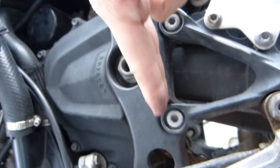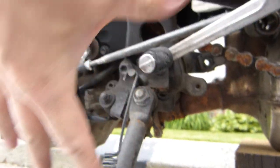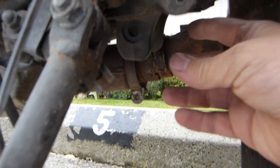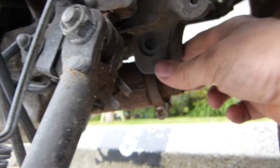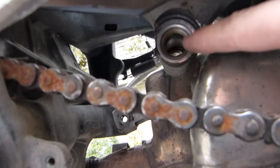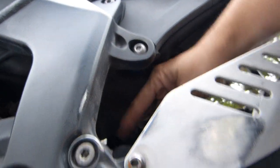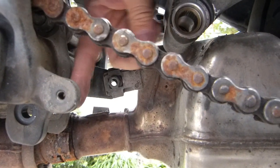This part of the frame is the extension of this vertical or near-vertical spur that comes down here, and this is where the gear shifter is. I've removed this lower body fairing here — this is the kickstand. That's the engine's sump here with oil in it. This is one of the lower mounting points and this is the other. The upper mounting point is here and it comes down pretty much vertically and ends here, mounting both there and there.